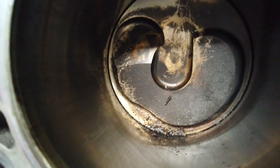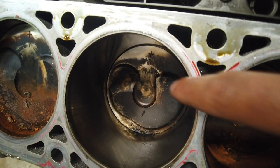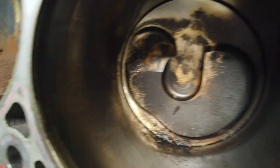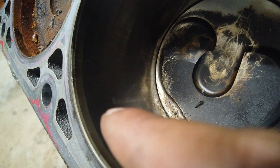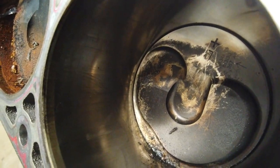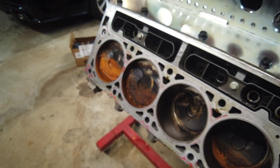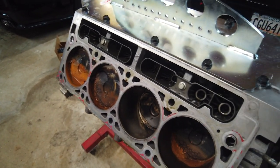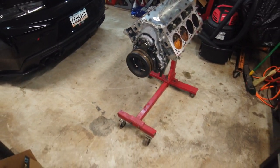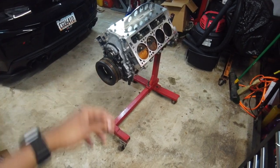I know the bottom of the piston — the skirt — is missing. The top looks okay. If you took this motor apart and didn't take the bottom end apart you would not be able to tell. I really think Hunter will be able to fix that — it's not bad. We'll really have to hone this thing and clean it up really good. The pistons do allow for that, but we'll have to make sure the ring is good on this one particular piston. Other than that it should be good to go — great news.